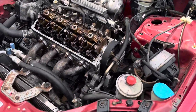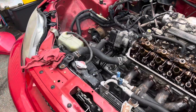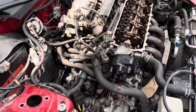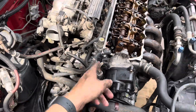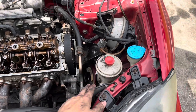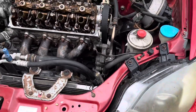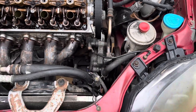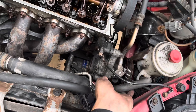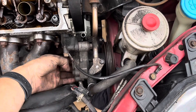The swap's pretty much wrapped up — got the cruise control, power steering, AC compressor, everything bolted up, lines connected. The harness is done. The only thing left is the intake pipe so I can get these last few vacuum lines on the valve cover and all that. Still need to get the power steering and AC belt on, so I gotta take the torque mount bracket off, slide the belt on, then do the power steering adjustment. Right now everything should be fairly loose as far as the pump and stuff moving.